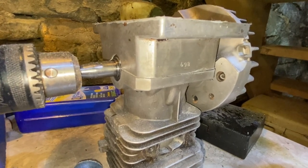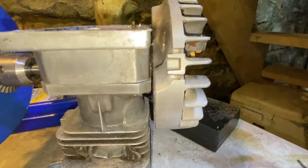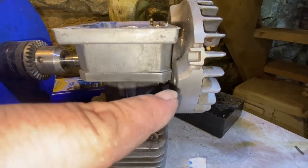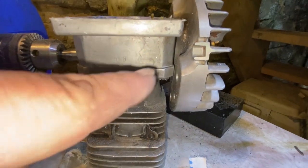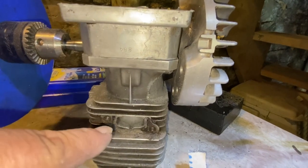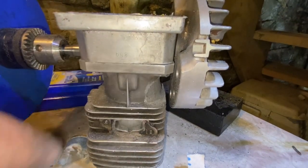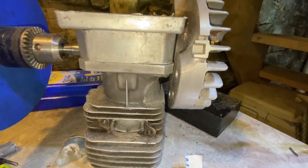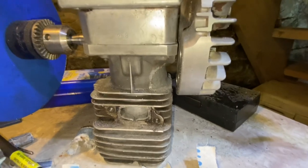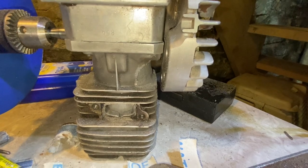It takes a long time to do it, but that's how I've been doing it on both sides. If I took 30 thousandths out of this side, I made sure I took 30 thousandths out of the other side. Then I make my final tweak at the piston — I measure squish all the way around, and as long as I come up with the same squish number the whole way around I feel like I should be good and square. It's not perfect — it's as close as I can get it without having the machine shop available. I just do the best I can with what I've got.